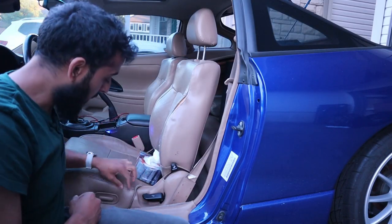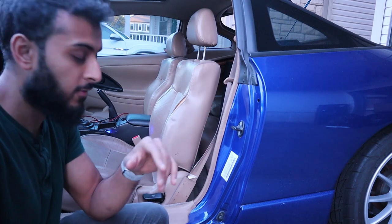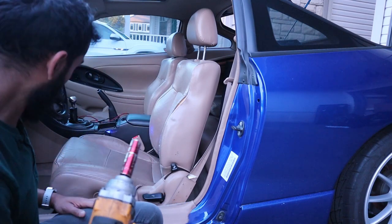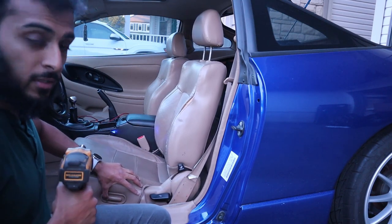The eBay brackets were cheaper — quite a bit cheaper — so I went with that. We're going to see if there are any fitment issues; hopefully nothing too bad. It might need a bit of drilling. We're going to pull out the current seats and start test fitting. We'll be saving some weight too since we're pulling out the electric motor. All you need is a 14mm socket. I don't think there are any airbags in the seat, so I'll just start by loosening it up.